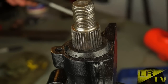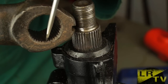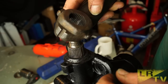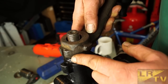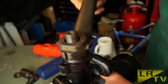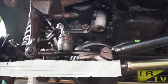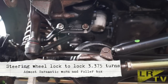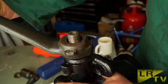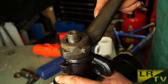For refitting, this Land Rover has master splines on it. You can see this large master spline here, corresponding with the drop arm — or pitman arm if you prefer. There are four of them, so you can mistakenly get the arm round the wrong way. The slot and the hole on the steering box must be aligned. You can turn the steering box to make sure it rotates fully one way and the other. If you've got it the wrong way round — which I'm going to demonstrate — it won't line up at all. As demonstrated on the vehicle, the sweep of the drop arm is not very excessive. You can see it drops on, but it is in completely the wrong position. Be very aware of this; the hole and the slot must be aligned.